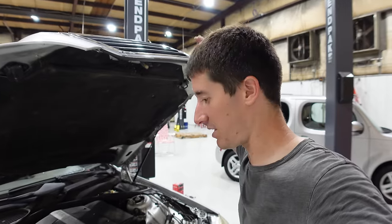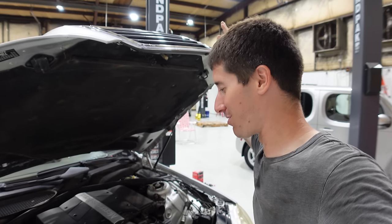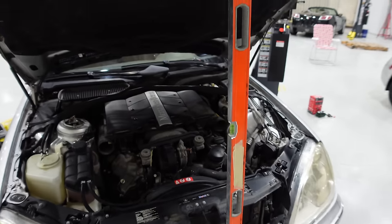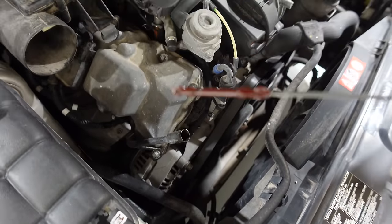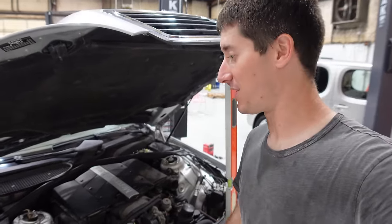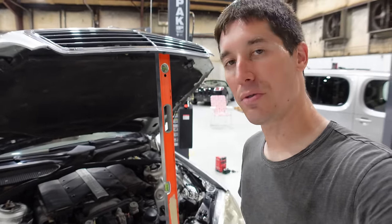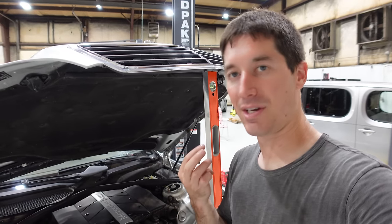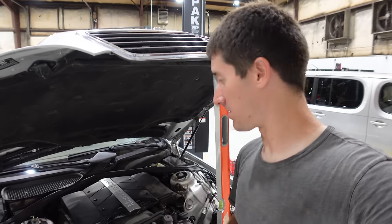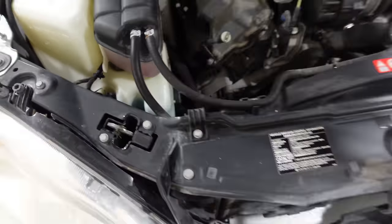The hood struts are bad - I'm holding it up with a prop. There's a pretty nasty tick; some people mentioned it's either low on oil, a chain tensioner, or chain guides. I checked the oil and it looks perfect, which lends credence to timing chain issues - either the guides or the tensioners. With hydraulic tensioners, that's a multi-day project to pull everything off this engine. Chains, guides, accessory belt, all the seals - it's a lot of work.